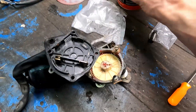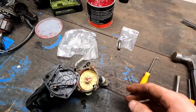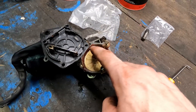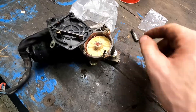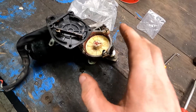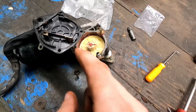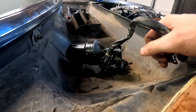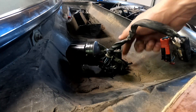We've got the gear back in there. We put some red high temperature grease in there - just kind of a general grease. We looped all underneath it, lubed the splines of the drive gear for the motor, where the shaft sits, the ribs there. We put some grease there, all along the outside, all along the bottom, filled it up to make sure it's nice and lubricated. Got some on the teeth of the gear as well. We're going to seal this up, put the screws back in it, and plug it in and see how it goes. We're plugged back in - we need to make sure our battery is attached, and we're going to give this a test.